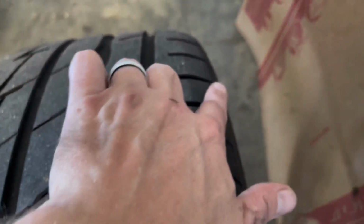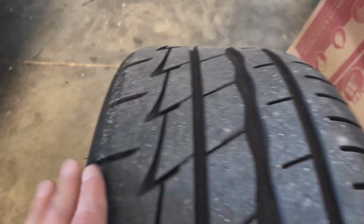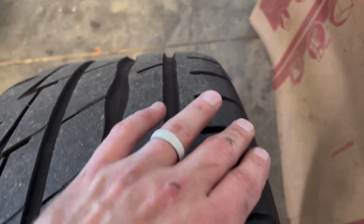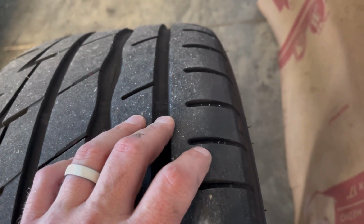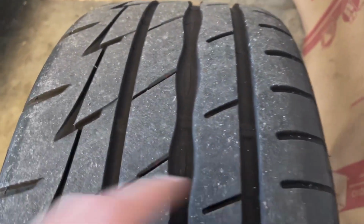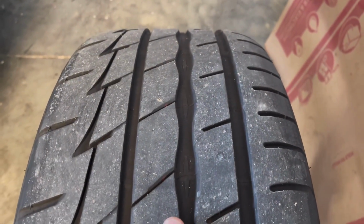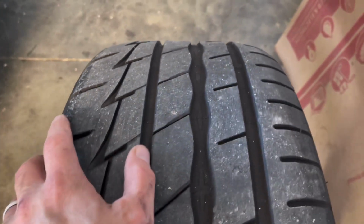Just analyzing the tire tread here a little bit too. This would be the inside shoulder. It almost looks like it's running more flat right on this very edge of the shoulder compared to this. It looks like we still have a pretty good contact patch, but what we don't want is to wear the inside shoulder out prematurely. Being lowered about 2 inches, like I have been for the last several months since installing the BC coilovers, there wasn't any real unusual wear, slightly faster on this side. You can see the outside shoulder still has these little nubs, and we do on the inside shoulder as well, but some of them are missing, starting to get worn out. So we're wearing pretty evenly, but what we don't want to risk is wearing prematurely on the inside. I want to get as many miles out of these tires as possible, so I think it's good that we're raising it up another 1/4 of an inch in the front.